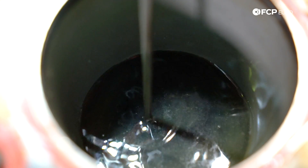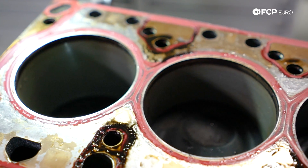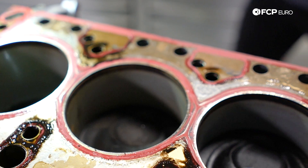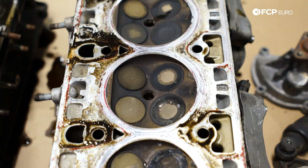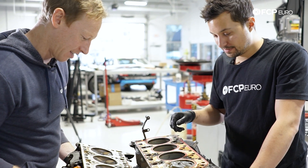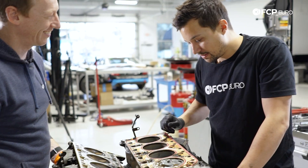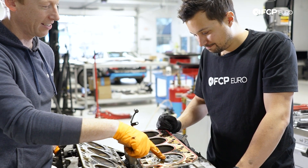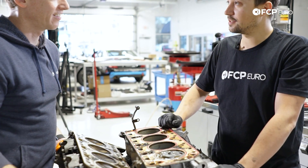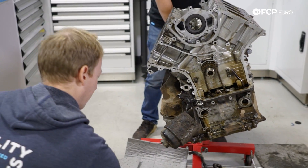There's your smoking gun. That one wasn't down to compress — this one definitely tried. There's some sludge in this one. This side is definitely looking a lot worse. The valves are clean, head's totally fine. This cylinder still has a good two millimeters of water in it — and shouldn't that piston be all the way up? I'm pretty sure this piston is supposed to match that piston. Cylinder walls look great; it never made it up.